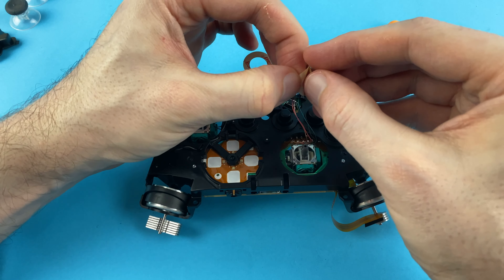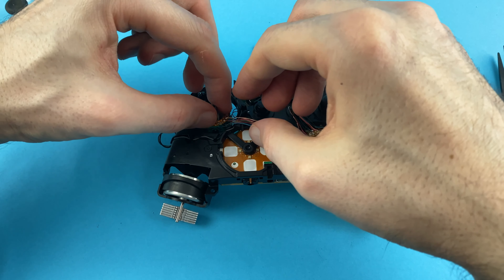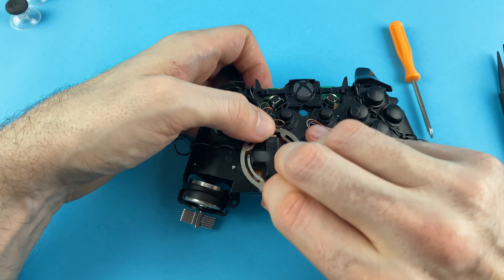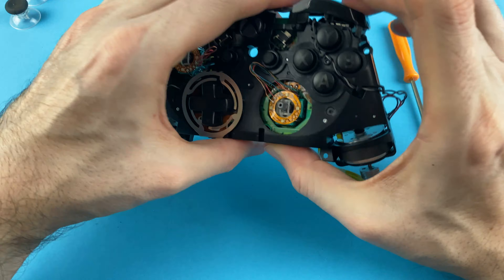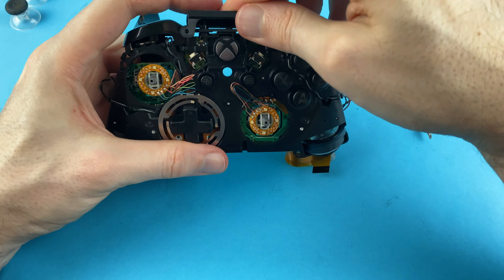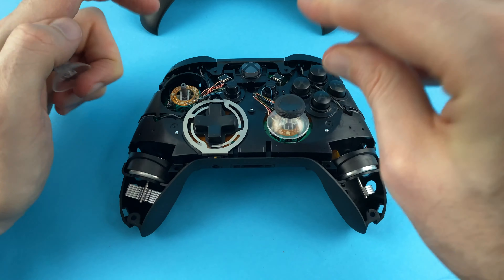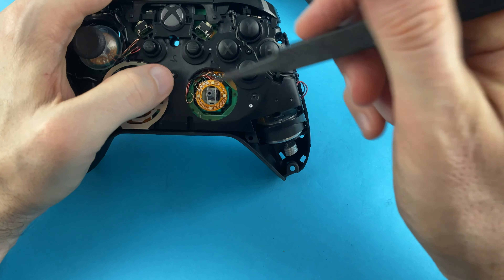Next we turn the controller over and peel off the backing of the two thumbstick rings, then simply place them on top of the thumbstick as shown on screen. Next we put the D-pad in, insert it, and put the metal ring back on top to hold it in place. Then we put the shoulder bumpers back on — they should snap in fairly easily; just check the sides to make sure all clips go into the right places. Don't forget to put your sync button in before you do it. Check that the bumpers still work as expected and that the triggers have freedom of movement. Then take your new thumbsticks and reconnect those, making sure you tuck the little LED cables away so that when you move the thumbsticks the edges don't press against those cables and break them.